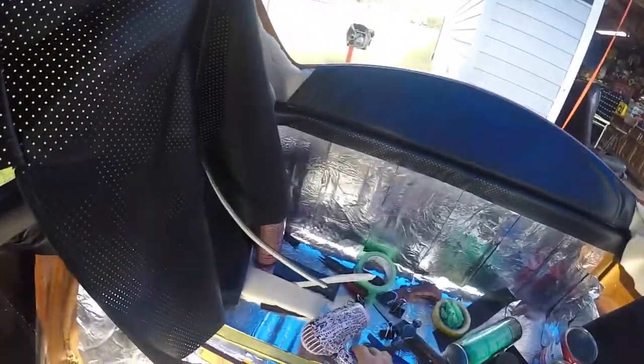I'm going to try to get this on film because I'm sure this is going to be the hardest part. Once you get past the rear window it starts getting easier. Of course it's a little different with the sunroof but I'm going to figure that out and show you how I do it. Get your blow dryer ready — don't use a heat gun, you'll probably destroy the vinyl. Get it heated up because you're going to want to go to the other side.